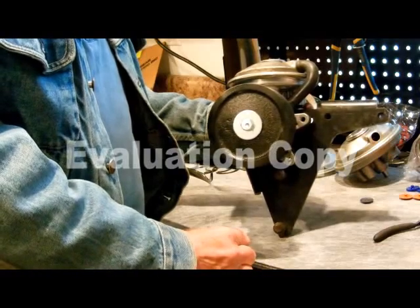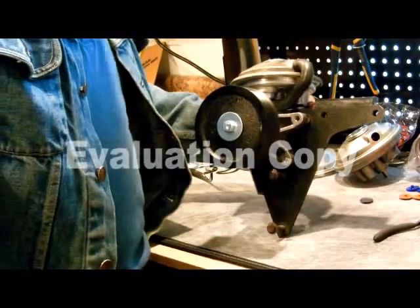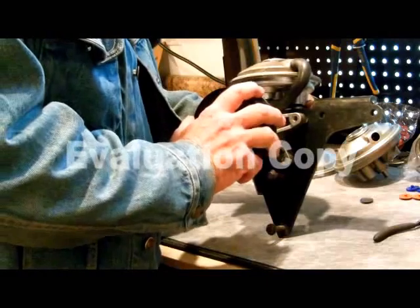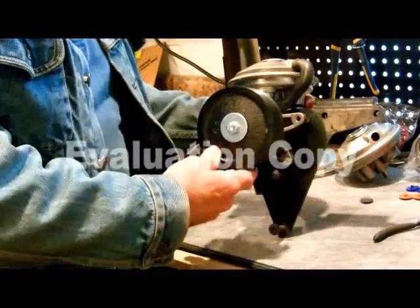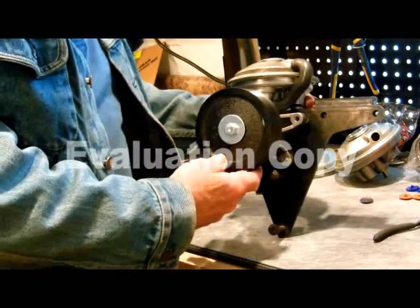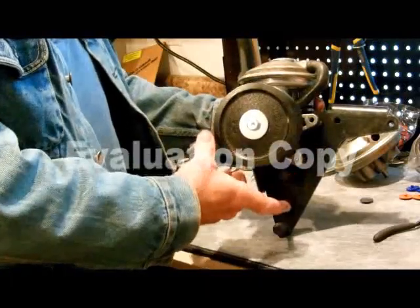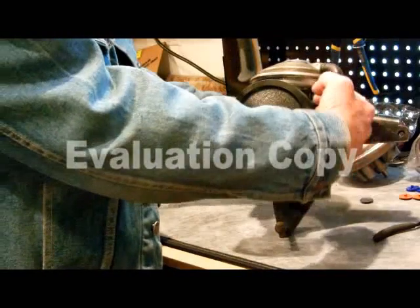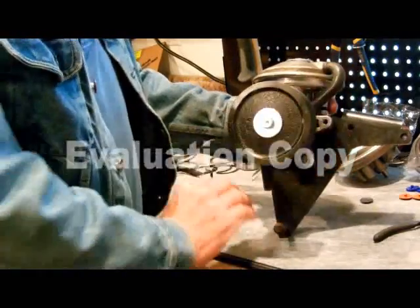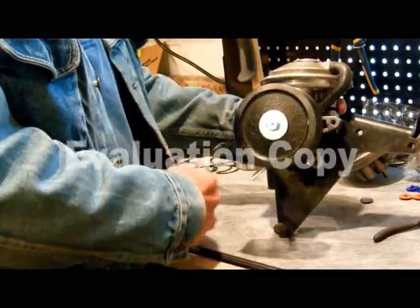This is how the vacuum pump sits on your engine block under the hood on this big black bracket with a couple other accessories. What you have to do is unbolt the vacuum pump on the bracket — take the bracket off the engine, and this is just what you're going to have in your hand after you pull a few bolts off. The serpentine belt is going to be around the pulley, so you find the belt tensioner and release it, and just take the belt off the pulley gently so you don't lose the rest of the belt routing.